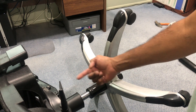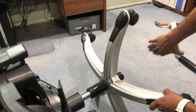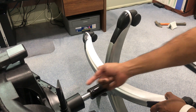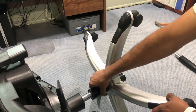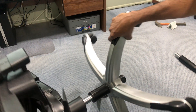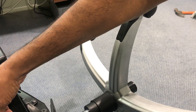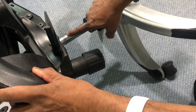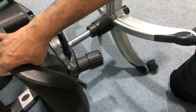Now we have to hammer this part in this direction while at the same time holding the leg and pulling it towards you. So essentially you're hammering the cylinder from the bottom on one side and pulling the leg towards you so the cylinder body gets free from the leg rest. Before doing that, let me show you why it started sinking — if you zoom in you can see some kind of a leak, which is responsible for the chair sinking when someone sits on it.